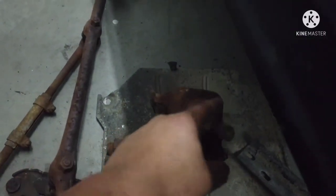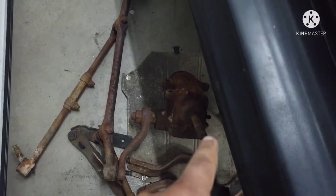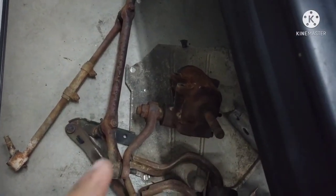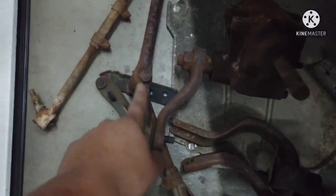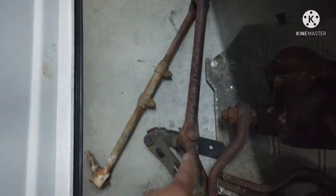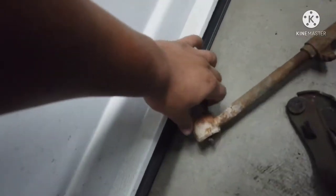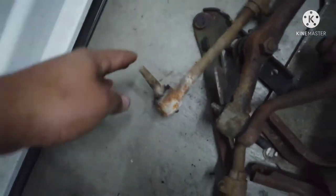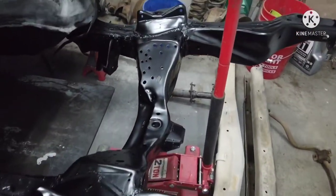I've decided I will switch over to power steering. Been reading up and I think I could use the Jeep power steering on there — around a '94 Cherokee, you can swap the power steering box out along with the steering shaft. Might also look into getting new linkages for the steering. All the tie rod ends and positions would need to be replaced anyway, so why not just go all brand new? Just a little quick update before I start really diving into the suspension.